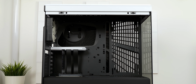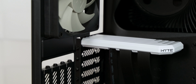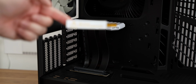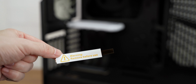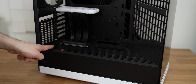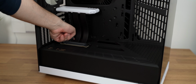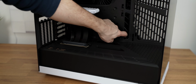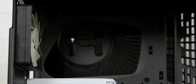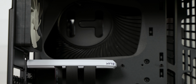When we look inside the case, the interior layout is familiar and of course the PCIe riser will immediately catch your attention. I said it before and I will say it again, it's the best looking riser on the market today. It totally deserves the name luxurious riser. It's Gen 4 by the way. There are more cable cutouts this time, especially on the bottom shroud, but the ones on the side for the major motherboard cables now come without rubber grommets. Large cutout on the motherboard is present here as well. It's a slightly unusual shape as the case interior follows this design to a certain point. Up top there is a wider than usual cable cutout.